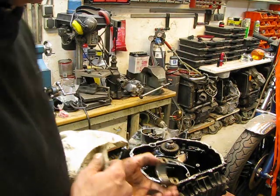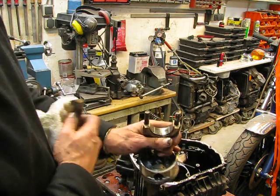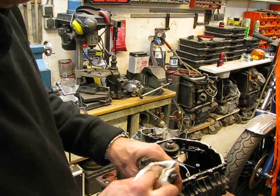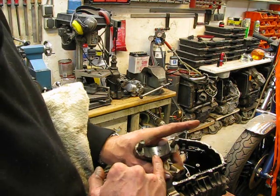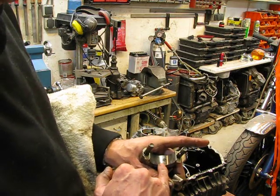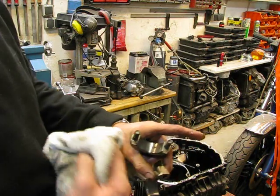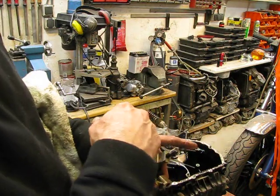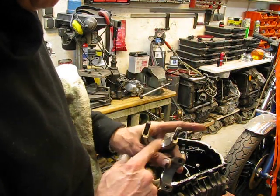But this bearing is also rubbish. Let's see the other one. Also a piston, also staying a very long time in the engine doing nothing. Moisture. The top layer is gone and we are going to a hard layer, and that is not what we want, because that will damage your crankshaft. The crankshaft I think is 100% usable for next time, but this one not.